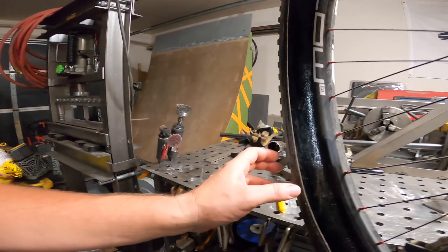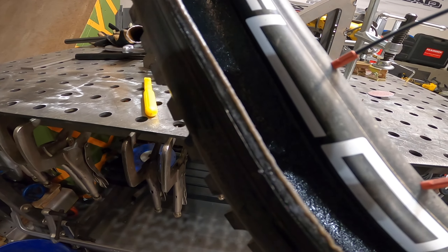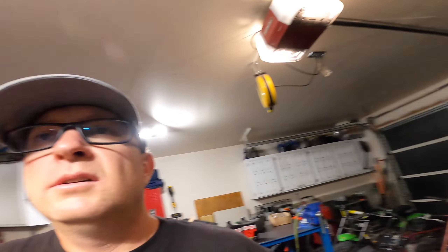I've got the rear tire here, I just popped the bead, and as I suspected, you can see that's pretty much dried up. Same will be for the front — I'll still pop it off. I take that opportunity to go ahead and knock any of the thorns that have come through off, and we'll put four and a half ounces in here. That's what I like to run.